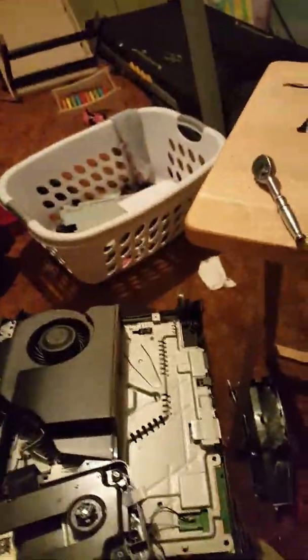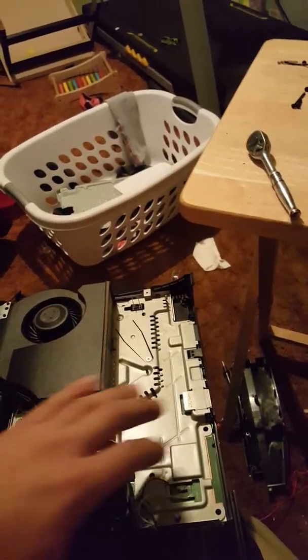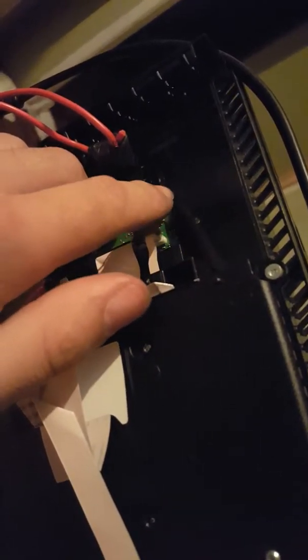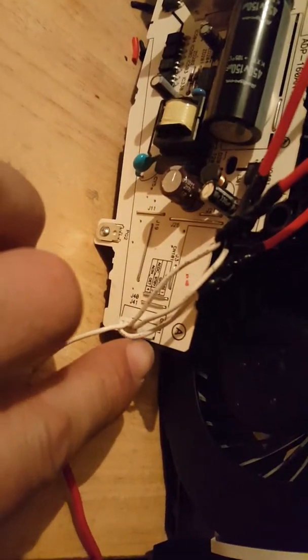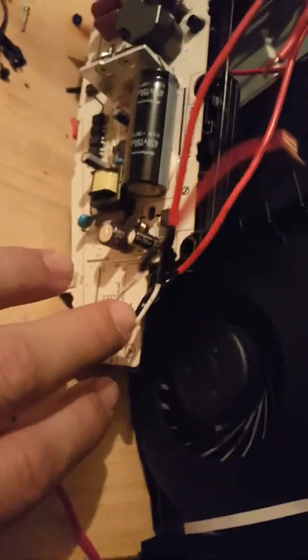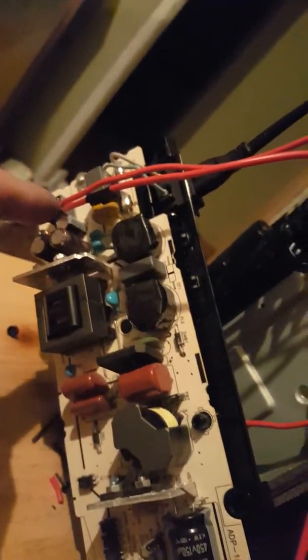So I got an old PS3 and I took out the power supply from that. I rigged it up to the PS4 — the 4-pin connector from the original one, I cut it in half and rigged some wires going to the PlayStation 3 4-pin connector. I just matched them up and ran 12 volts to the ground over here.